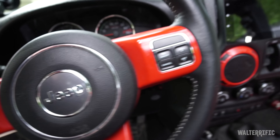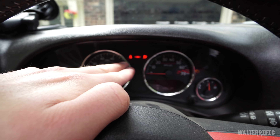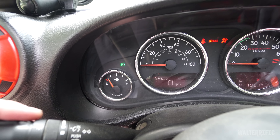The main thing we're going to do is try to customize this dash — red, like I painted the rest of my stuff. We're also going to try to change the LEDs. I want to change the color of a lot of them. One thing I really want to change is there's a seatbelt and airbag light that are on constantly, because I replaced the seats — they're not plugged into the original seat warmers. I'm just going to remove those LEDs. For the most part, all the lights are going to be red, with some exceptions — turn signals from green to yellow, and high beam from green to white.